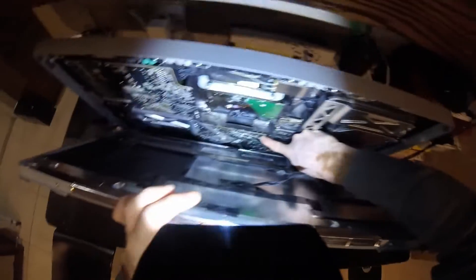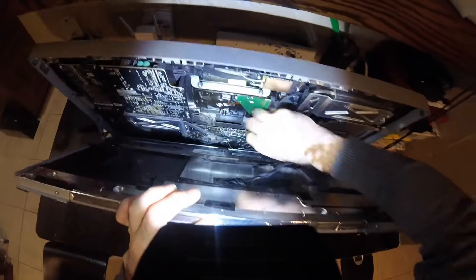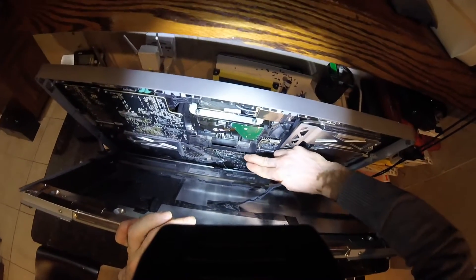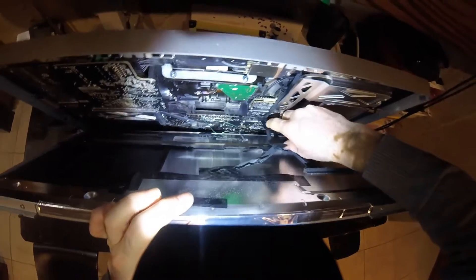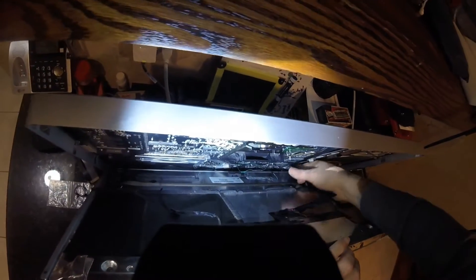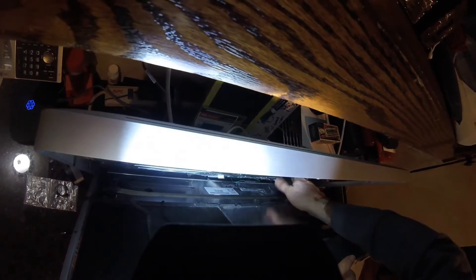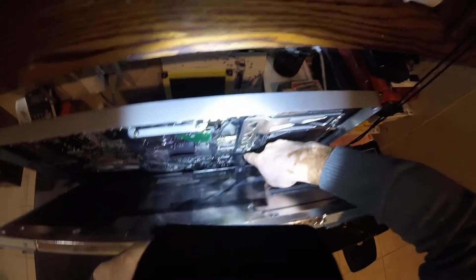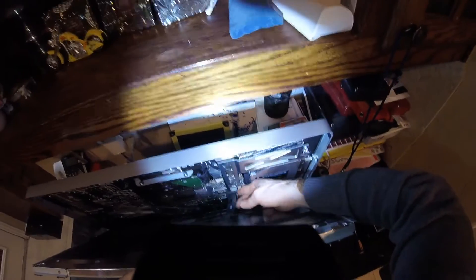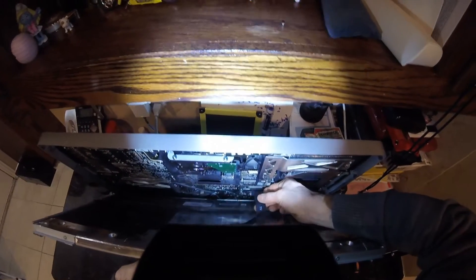Use your fingernail to pry the little tab on top and push it down straight — that should pop the power connector out. Then there is a temperature connector for the LCD — it's a two-wire connector; you can see the wire going onto the LCD. Again, use your fingernail to pry it straight out. The last one is the display signal connection — think of it like your HDMI. There is a black tab here, and you push it in to unlock the connector, then pull it straight out.